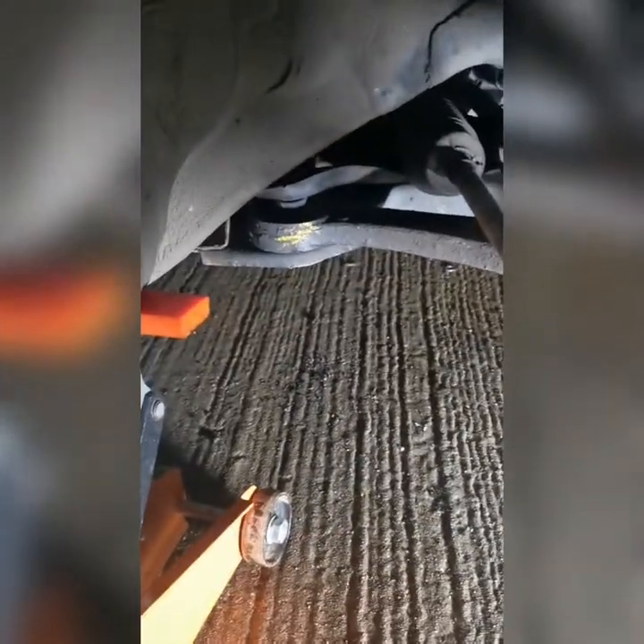What I'm trying to get to is where that mark is, because I've taken my car to get its MOT and it failed on this bush over here — so that's what we're replacing. It's not simple to just replace that one; it makes more sense to replace both of them. That's what it's attached to, and that is where you can make your adjustment for your camber.